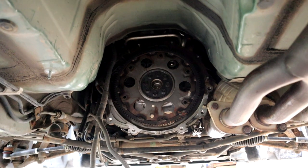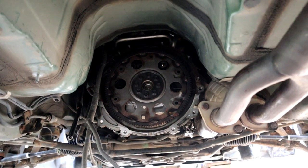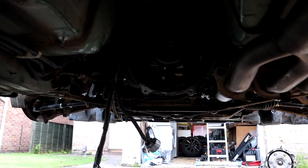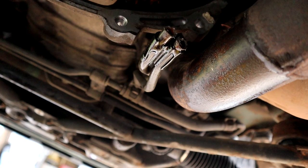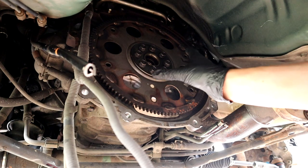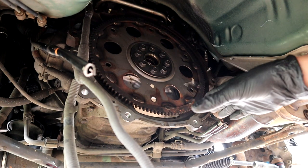There's the flex plate that we've got to remove next time. That shouldn't be an issue — just whip those bolts out with the gun. I think there are eight bolts. All the wiring isn't needed so we can bunch it up and tie it somewhere, and I think we wire the reverse switch to this one. We'll get rid of those pipes from the other side; they lead to a heat exchanger on the engine. Recording this three days after the last part because it rained. Now we're taking the flex plate out — eight 14 millimeter bolts.